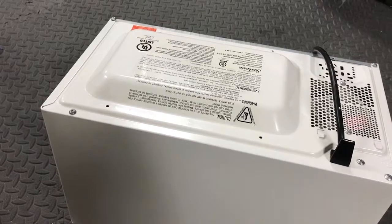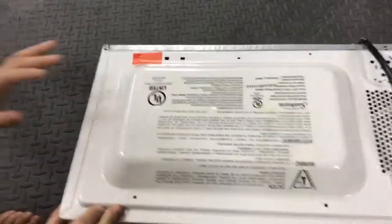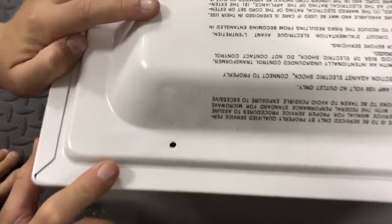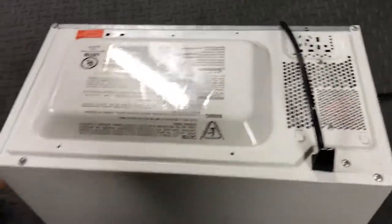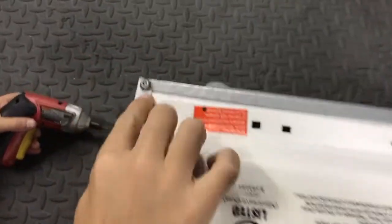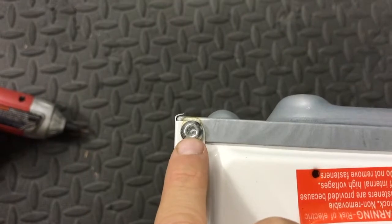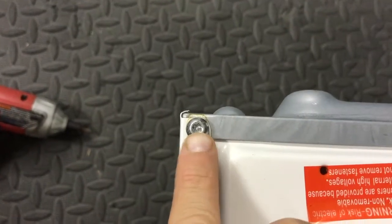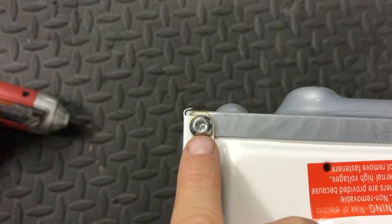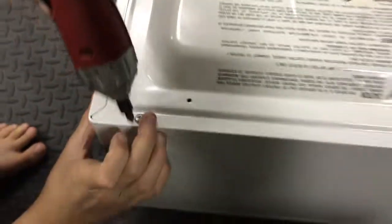To start off, you're gonna have some Phillips head screws here, here, here, here, here, and here. But then these right here are tamper-proof screws — see that little dent right there? That prevents you from using a normal screw bit. I'll explain how to get those out in a sec. First, let's get these other ones out.